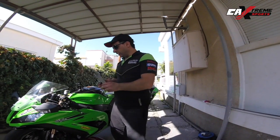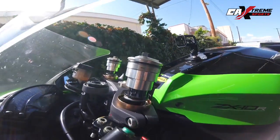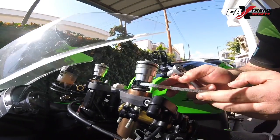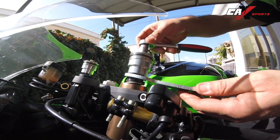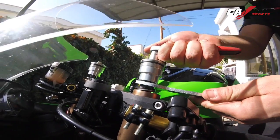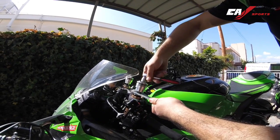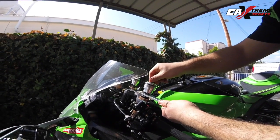Okay guys, now we need to remove the top cap and take out the spring. So we use the KT tool from this side, not here, and we put it in there like this — 14mm tool for the preload nut. Now you just unscrew slowly, slowly, and let's hope that the cap is going to come out.